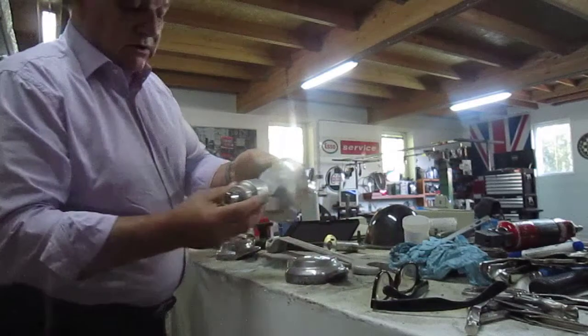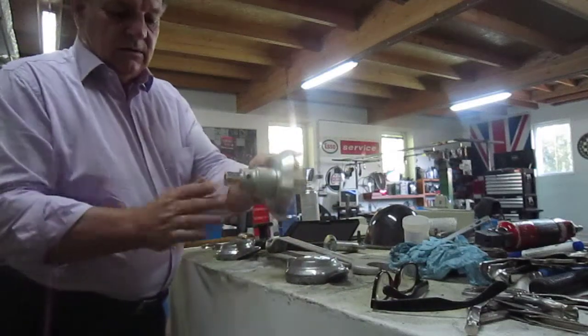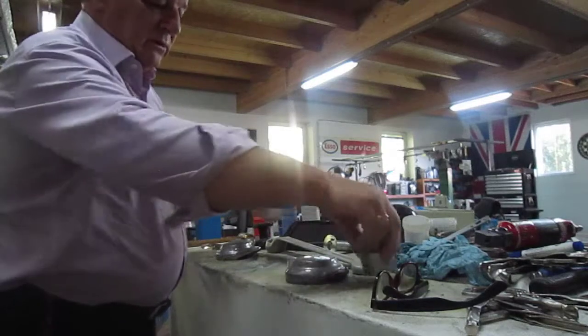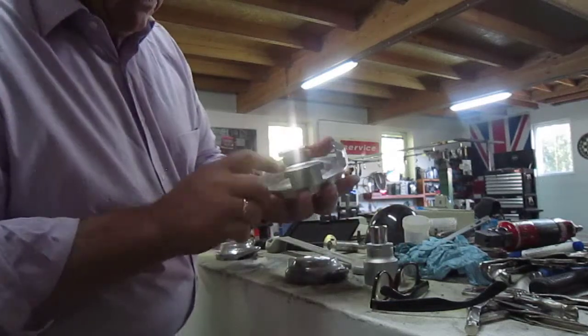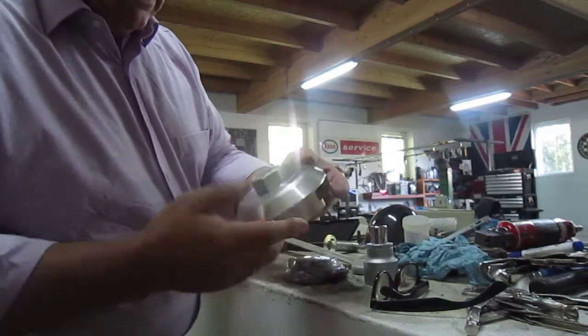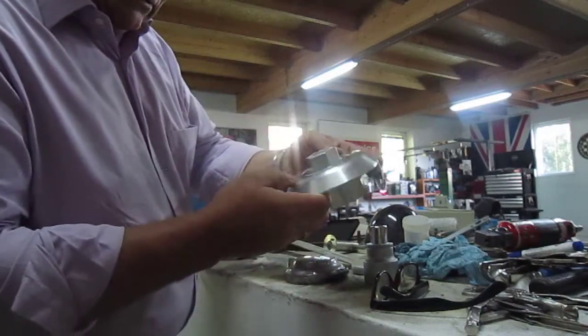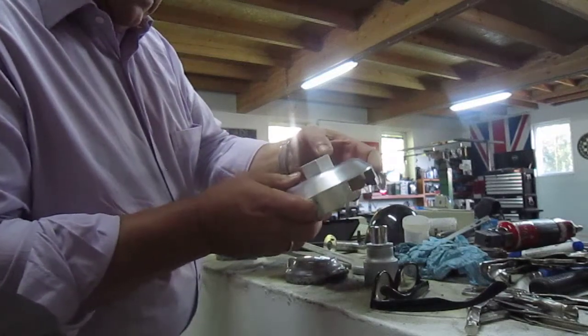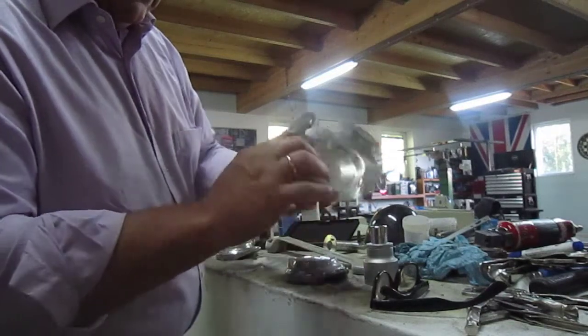You want to use a socket so you're outside the wheel arch, particularly on the front of the car. It's absolutely beautifully made from one piece of aluminium — it's one billet. It's even got the Jaguar logo and everything on it. It's unbelievable. Jaguar: left to undo, undo right. 38mm or 1.5 inch socket only.